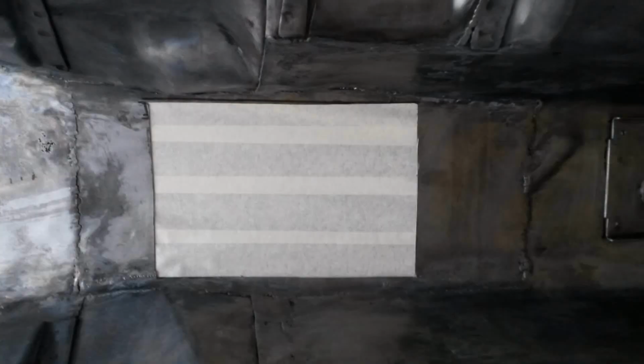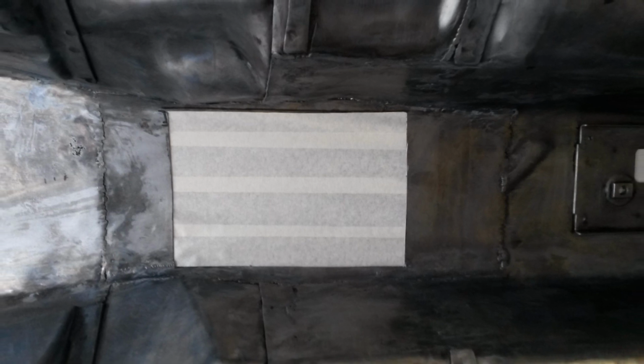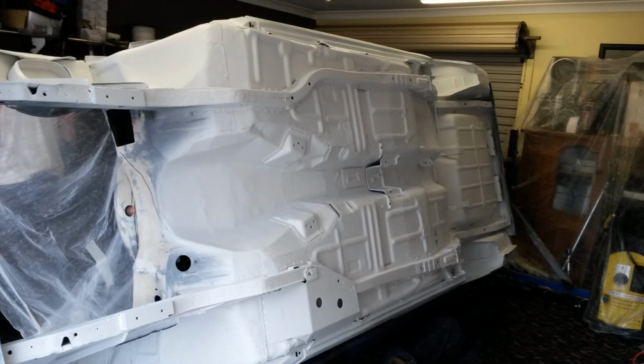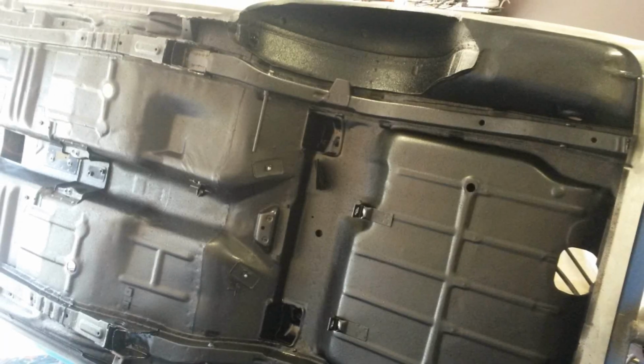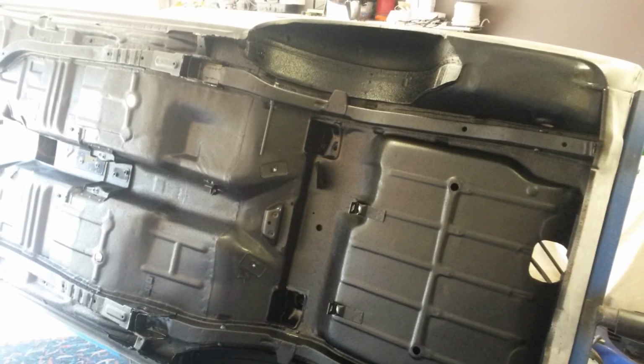The only mod that was done to the whole undercarriage was to relocate the shifter access hole. The easiest way to do this is to block up the old hole and just recreate a new one. Once it was cleaned, we sealed all the bare metal with 2K epoxy. After that, we seam sealed the whole undercarriage and sprayed the whole lot in 2K satin black. After the paint, we sprayed body deadener on everything except suspension links and mounting points. The whole lot turned out really nice.